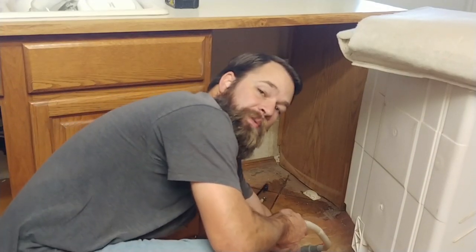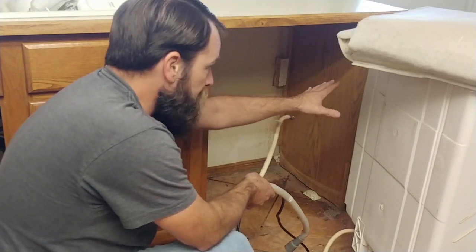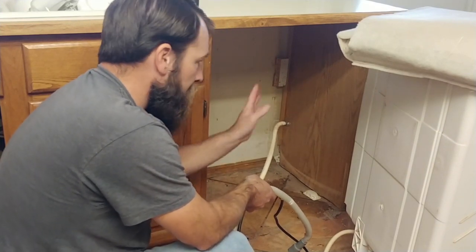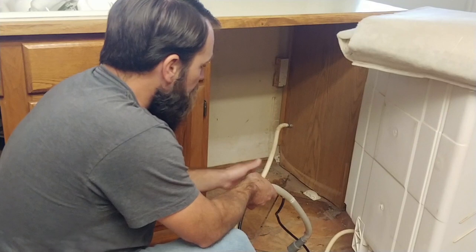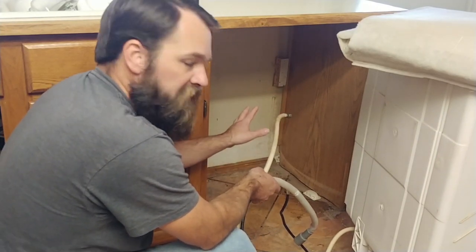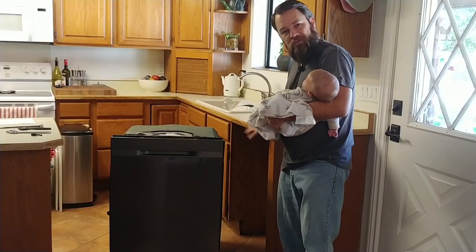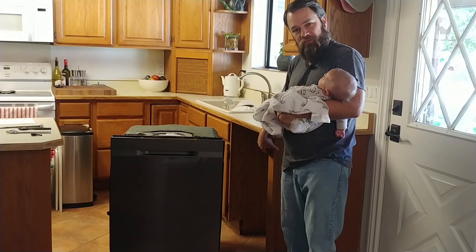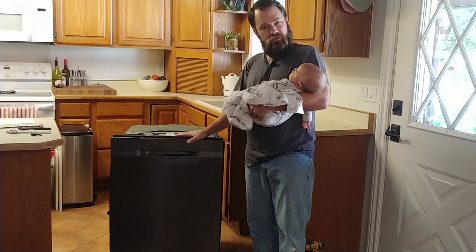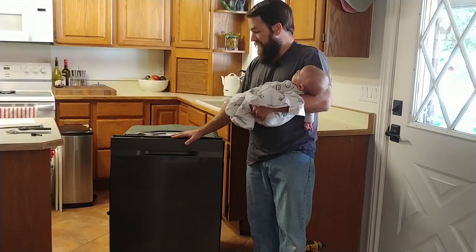The next thing I'm going to do is clean up the space and get this panel secured. I'm going to check to make sure I still have 24 inches between the cabinet and the panel right there — that's what you're going to need. Now that I've got my space prepared, the panel is secured at the right dimensions — 24 inches, it's a standard size. I've got the new dishwasher here, got the old one out of the way, so now I'm ready to begin installing.